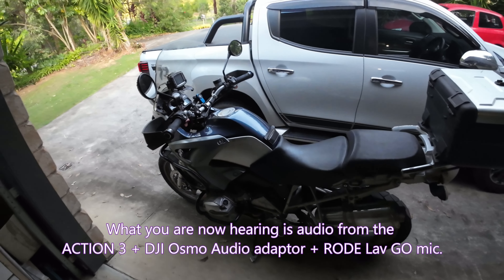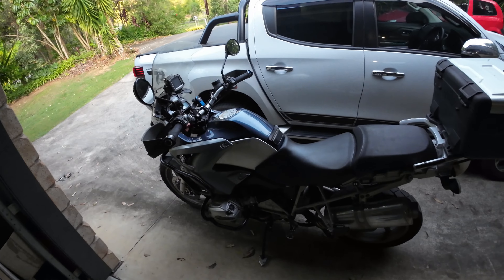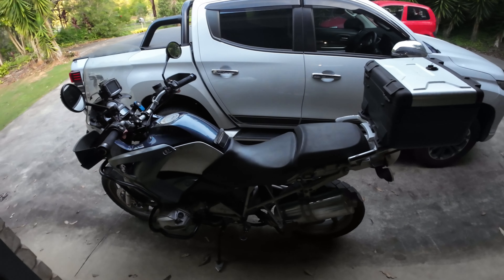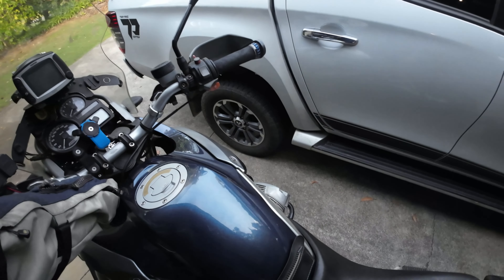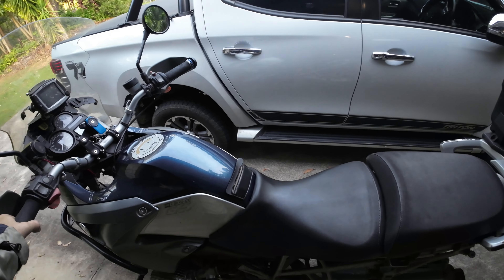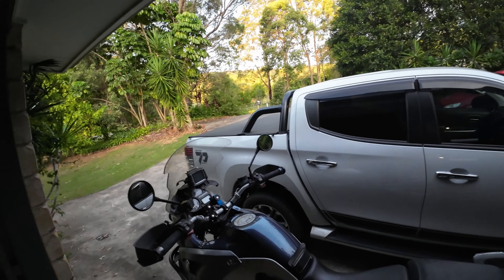Taking the GS out. I've just been thinking - I've had it for 14 years and had hardly any problems with it. Then on the way home from work yesterday it had a slight miss, and I'm thinking maybe coils or spark plugs, or even the fuel pump - that's actually been changed before, upgraded to another one. I put it on the diagnostic and it didn't come up with any codes. I also found the negative terminal on the battery was a little loose, so I'm hoping that might be it. Taking it for a test ride to try the camera out.